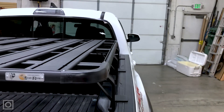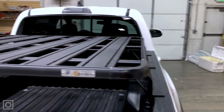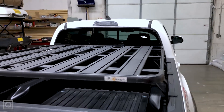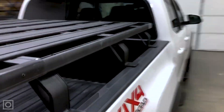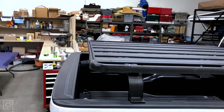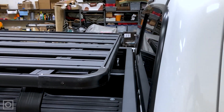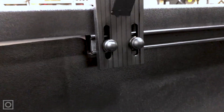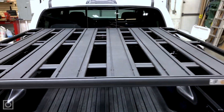If you look at the profile on this, it comes out right close to the edge of the truck on the bed rail there — it's a great solution. We have one more width you could use: you could go with a 1500 wide by 1400 millimeter, which would be 59 inches wide, coming over about two and a half inches on each side, putting it over the bed rail just slightly. We're open a couple inches on the back end and just barely a couple inches going over the front as well. This is as long a rack as we can put on here without conflicts — where we mounted this leg, we're on the bleeding edge of that mounting point, so a longer rack would expand us past it. The 1400mm or 55-inch long rack is as far as we can go.